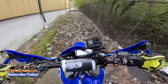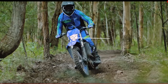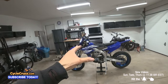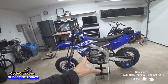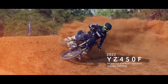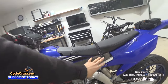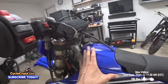Some of you may ask: why the YZ450FX instead of the WR450F that comes with a headlight? Well, that bike has emissions components on it too, and the WR suspension is really soft which sucks for the street — the YZ suspension is firm, which is perfect. I went with the FX version instead of the F motocross version because the FX has a five-speed wide-ratio gearbox, which is better for the street. The motocross F version has a close-ratio gearbox. The FX also has a kickstand and a center fuel tank — the only dirt bike I think, besides the YZ450F and WR450F, with a center tank.